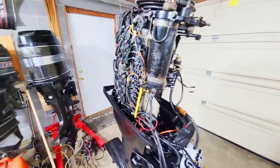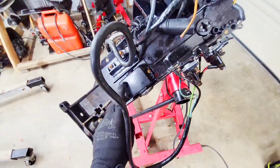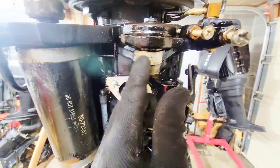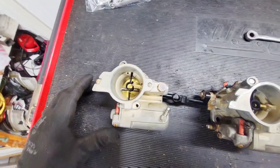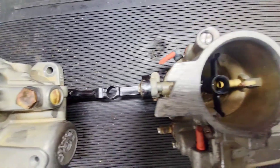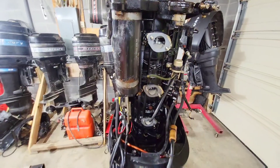Today's video is all about timing. I rebuilt all the carbs per spec. I still have the 115 here that I'm working on — it ran even though I didn't rebuild the carbs, and it has an idle stabilizer which I'm going to take out. I'm going to install the carbs first and then get the timing right, making sure everything is spinning properly. I got the carbs synced up — wide open, wide open, wide open, beautiful. I have brand new gaskets on those.